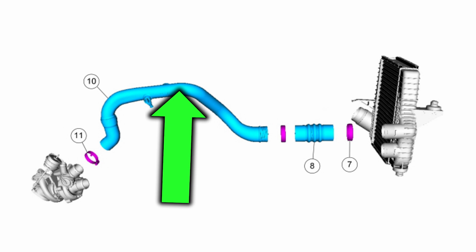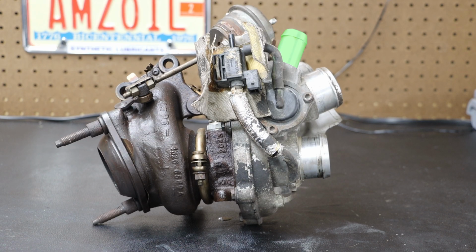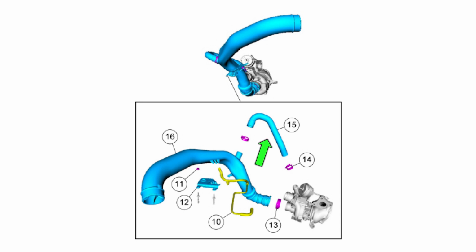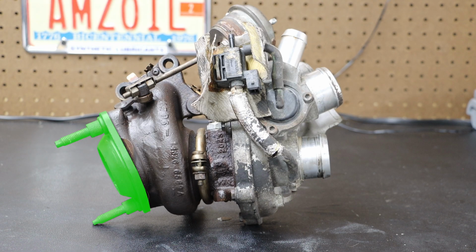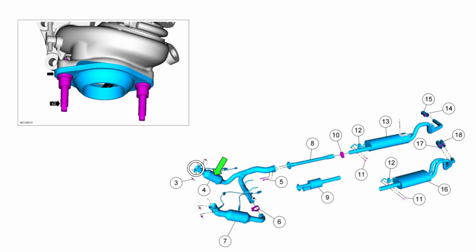The CAC pipe is the charge air cooler, and this pipe will go into our cooling unit. And then that third tube towards the top is our right hand turbocharger bypass hose. Now this one does loop back around and connect into our right hand air cleaner pipe to turbocharger pipe. Now the opening to the bottom left that has 2 stud bolts, this is our exhaust flange. This is what connects up to our exhaust system and that catalytic converter.